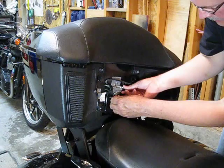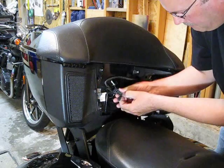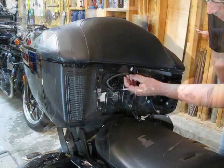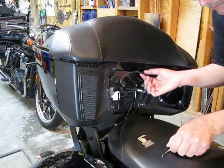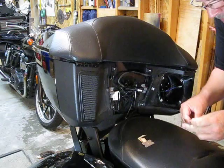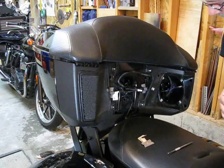Now I'm going to pull off the duct tape that's holding the stock wiring in place, so I have some room to work with. This is the wiring here that's going up and into the trunk lid, so this is the wiring we're going to have to work with. Now what is sure to be the most difficult part of this project is cutting through the wire sheath without actually touching the wiring on the inside. So I'm going to use a dental pick that I picked up at a local hardware store. I can start picking away at the sheath until I start revealing an opening, and then I can probably move on to a single-sided razor blade where I can start trimming away. Eventually, we'll start revealing the wiring that we can tap into.